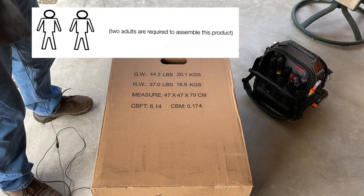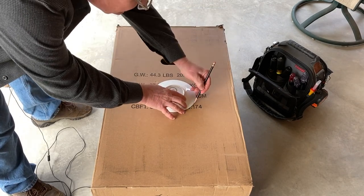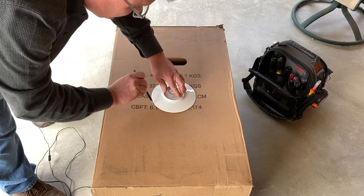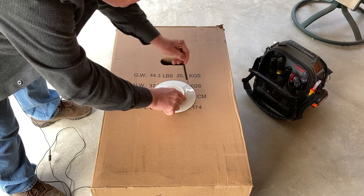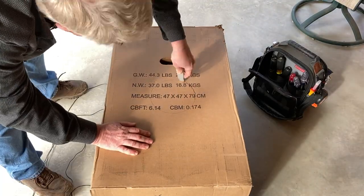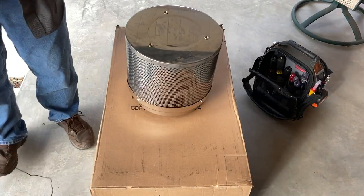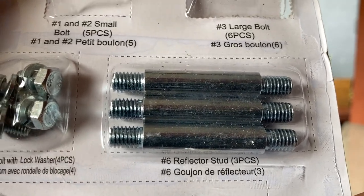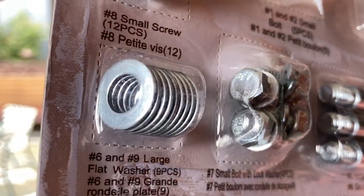The manual says you need two people to assemble this because you need someone to hold up the burner unit while you put hardware on the top with the heat reflector. But I guess they never figured you could steal a 6½-inch saucer from your wife's good china, cut a circle in the box with a slot for the controls, support the burner unit that way, and then do it all by yourself. So voila! Now it's time to put in these standoffs — they call them reflector studs — that hold the heat reflector away from the top of the burner unit. We also use some things they call large flat washers, but they look ridiculously little to me.